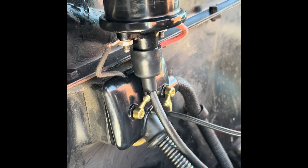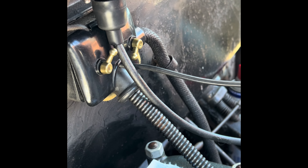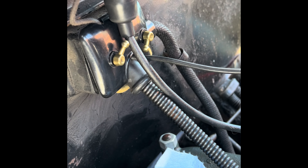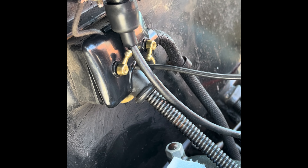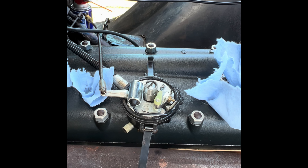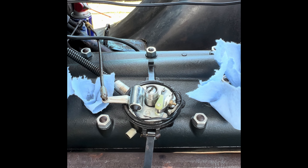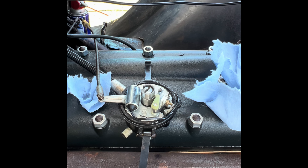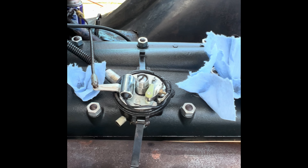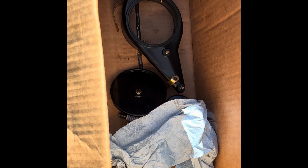I think I'm gonna leave the coil and see if I can make it run without a new coil. I have a new one just in case — I bought a kit with everything in it — but I don't want to put it in if it's not bad. I've tested it as far as I could and it seems like it works. Some people say it either works or it doesn't; some say it won't put out high voltage enough to make it run right. We'll see what happens. I'm gonna keep all the old parts, just cleaned up, to use in an emergency.